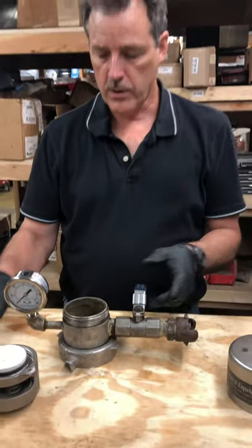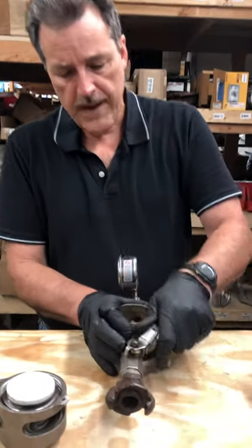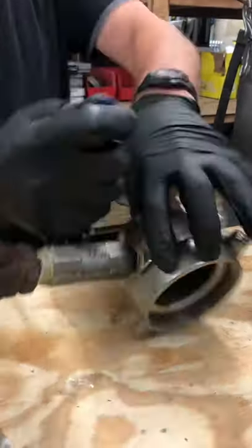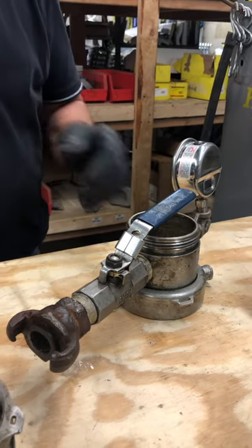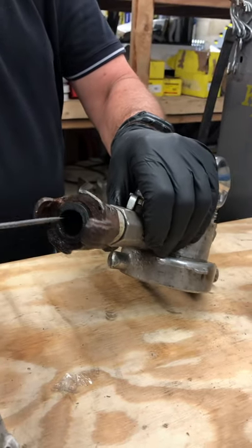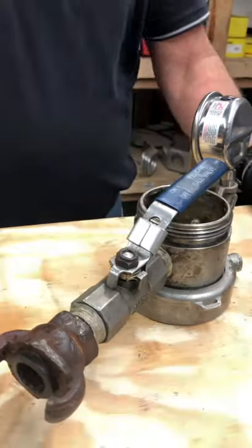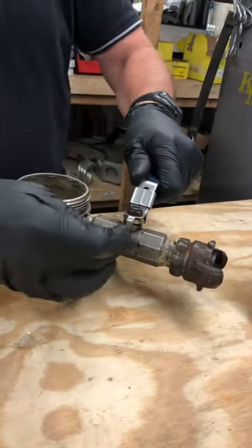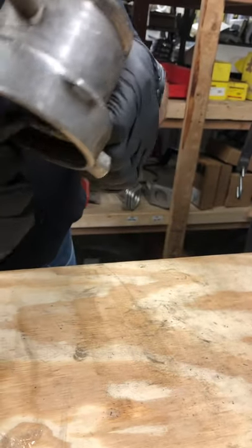The only other thing I want to show you is a lot of times drivers will say they're airing up but can't get any air into the trailer. Open the valve up while it's down or while you have it up. With the valve open, you should be able to take a pick and stick it right in through here so that it goes all the way through the valve. What we find a lot of times is if a driver has hauled something like wax or something that freezes up, this will actually be frozen in this part of the valve. So while the valve is open, make sure these are all clean and opened up inside so the air can actually go in.